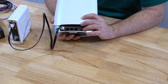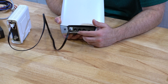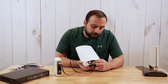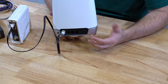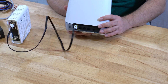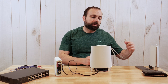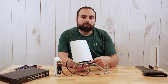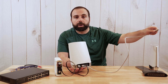The Orbi's yellow port is the WAN port. This specific model supports up to 2 gigabits per second, so if you got that plan you'd have to use both WAN ports. In my case, because my internet is 400 megabits per second download and 20 megabits per second upload, I only need one ethernet port, so I have three open ports that I can use. You can do a number of things with those ports — if you have a computer you want to hook up, you can pick any one of the three ports. It does not matter; the router will handle that for you.